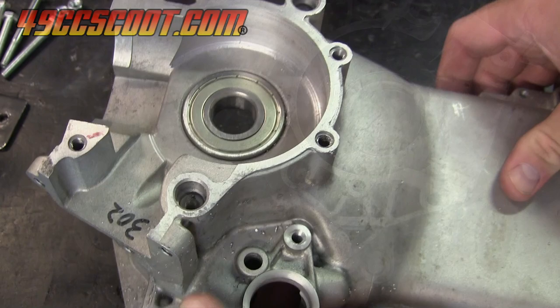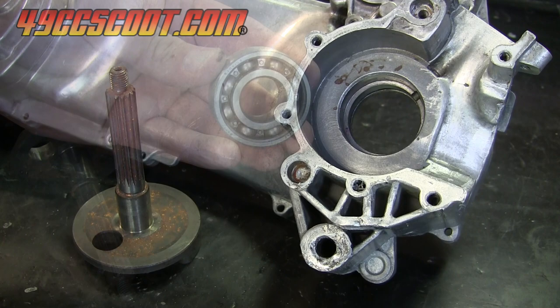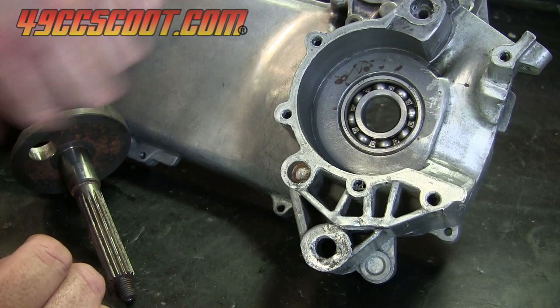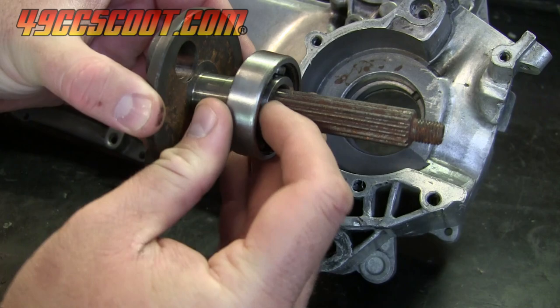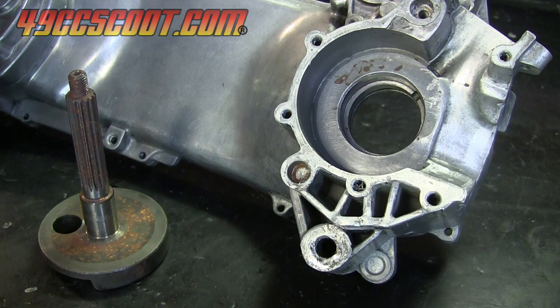For those that don't know, dummy bearings are bearings that have been ground or sanded to either a smaller outside diameter or larger inside diameter, or both. They are often used for mocking up engines or checking fit because they can be dropped into cases or slid onto cranks without heating or pressing. I thought dummy bearings could spin in the crankcase if the fit wasn't snug or if the bearing seized, and I'd rather spend a little extra time on bearing removal and installation rather than risking seat damage.